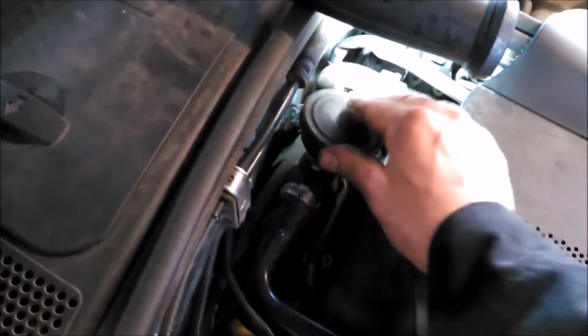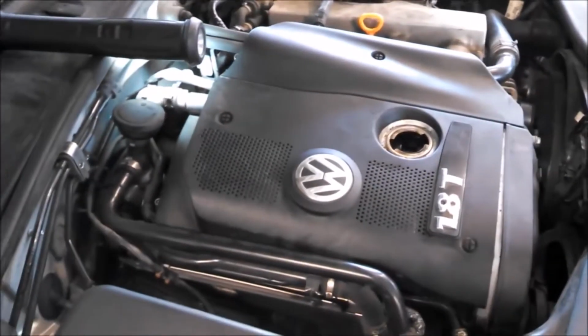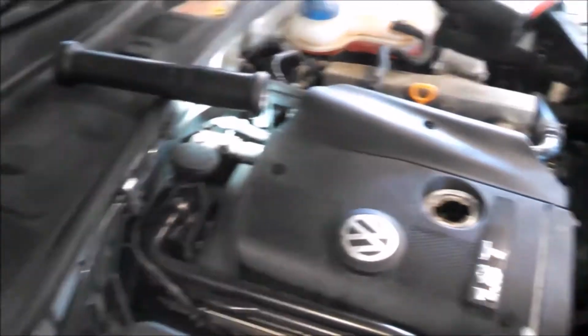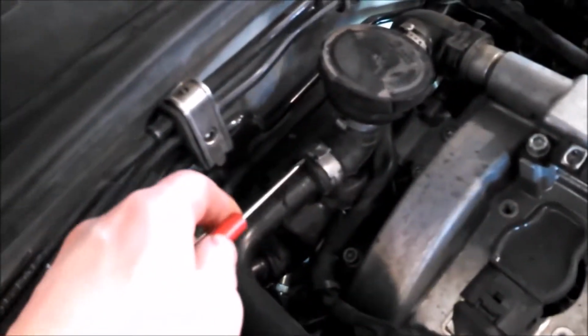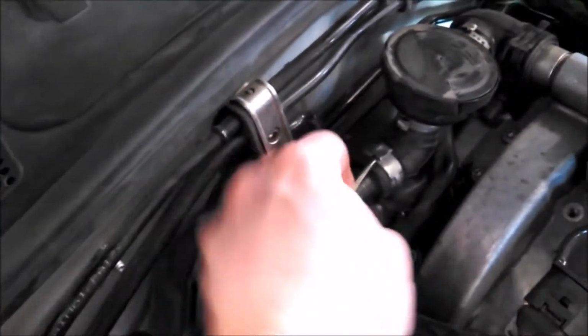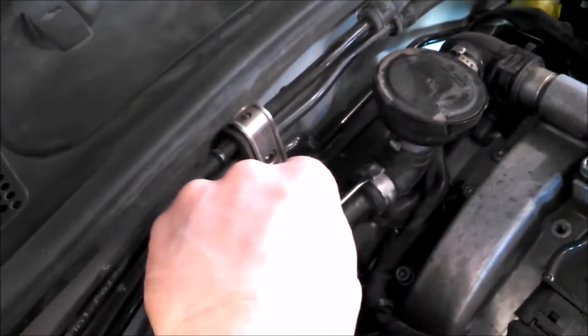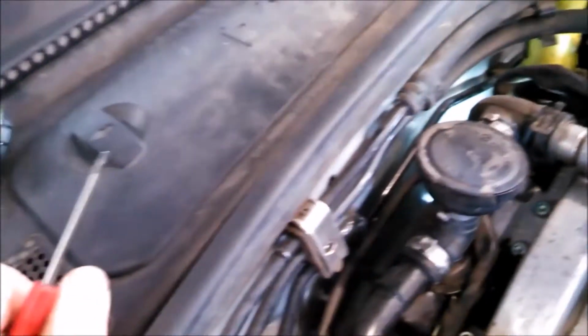It's down there. We'll probably be moving some stuff. I might do the thermostat too on this, so let's get started. I'm going to remove the cover just because, and then we'll get back there. So I'm going to try and use a screwdriver and loosen these clamps. This way, I suppose the other way is to actually just cut them off, and use different hose clamps.